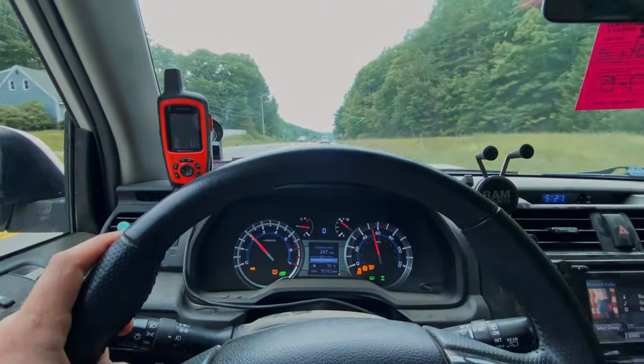This camping trip is just campground camping, so we're not really going to be doing any wheeling or anything like that. I'll keep fiddling with them and put them to their paces for real as soon as I can. It took longer than I thought, but they're in there — happy about that. I have been having some dash lights coming on and off intermittently, and confirmed that my passenger side ABS line is shot and needs to be replaced — there are a bunch of blinking lights, Toyota wants you to know when one of those ABS lines goes. I'll order the harness and pick it up when we get back in a week and get that on there. We'll just live with the lights for now, but other than that, really happy — can't wait to use these things off-road.